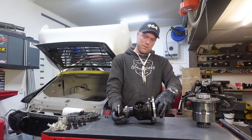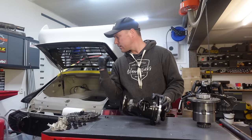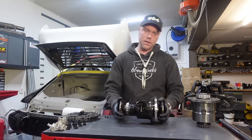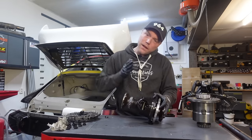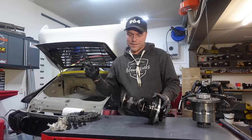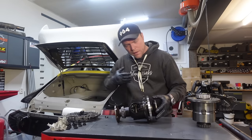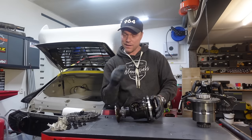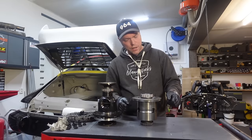Why is this relevant for a race car? You have a lot of power — look at this car, it's going to be really powerful. You get into a corner and the car leans, giving more grip on the outer wheel. As you try to accelerate out of the corner, your inner wheel slips and all your power escapes. You hear that — your inner wheel spinning because you don't have an LSD, a Limited Slip Differential, like this one from a Porsche 996 Cup.